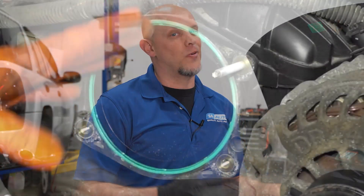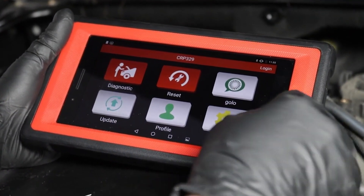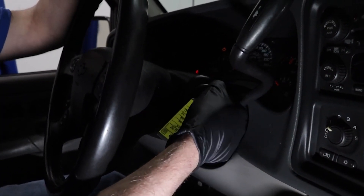After you're done cleaning the throttle body or replacing it, you're gonna want to replace the gasket as well. Certain vehicles require an idle relearn update after. You can use a scan tool, and sometimes you can do this manually without one. You're gonna have to run the vehicle for about three minutes, then shut it down. There may be a different procedure depending on the vehicle.